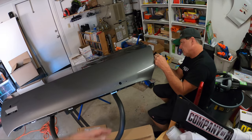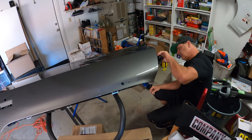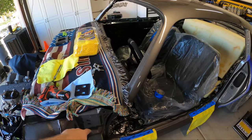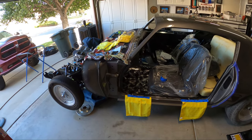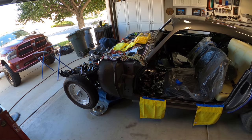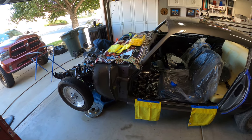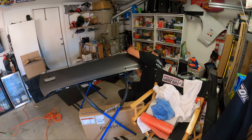On the doors, one thing I realized is I didn't tape off the bottom of the hinge — I left it exposed. When we were installing the doors you don't want tape there, and I didn't even think to tape them, so they got paint on them. The other side of that is there's added paint thickness here, which is different from when we mounted the doors during bodywork. So how much thickness did it add? We're going to have to shim or adjust things a little more. We don't have front fenders on yet, so there's nothing to tape on that side.